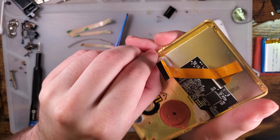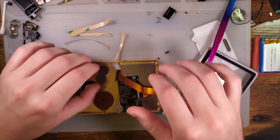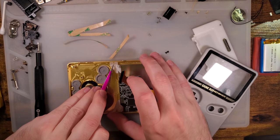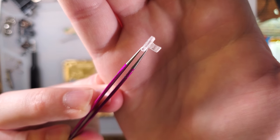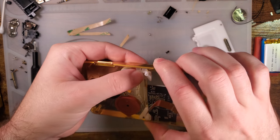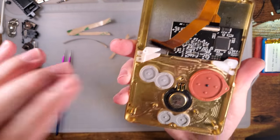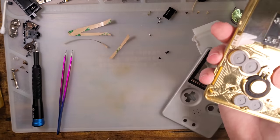The few that I tried have been very tight, so you might have to press fit it. The particular problem is, if you want to try working around it, but it's not too big a deal. Get this out. This is a print, and it curves off to the left slightly at the end. That's why it doesn't fit. The tolerances on these are unfortunately not perfect, but press it in, it'll go in, it'll live there. It shouldn't ever have to come out. You can still slip the screen out from the top, but having those in does help quite a bit.